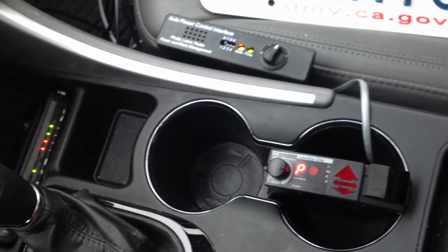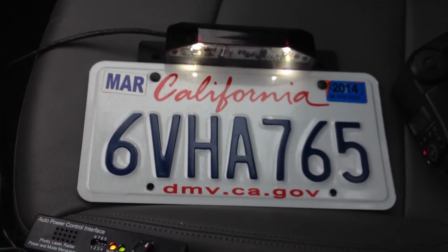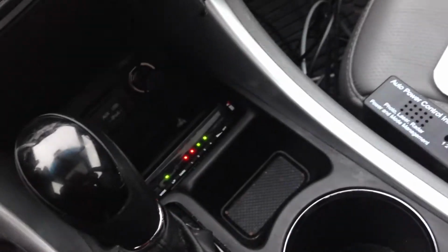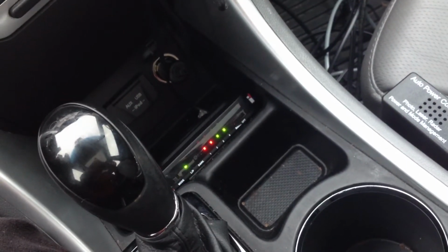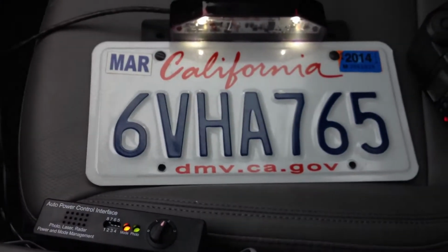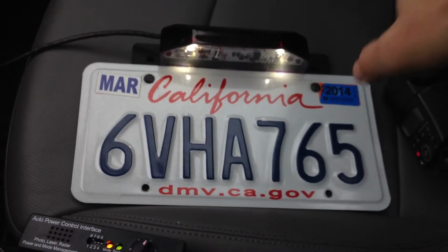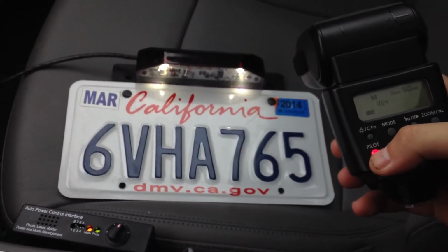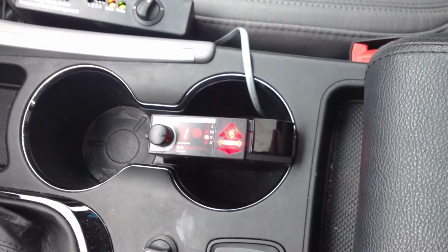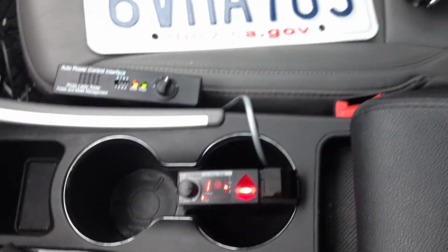The V1 has to power cycle again, as you can see. So when you do this, your ProDB is now also deactivated. So once you JTK, this will no longer respond to flashes. You've got your jammers here, which are now set to just receive mode, not to jam mode. Your radar detector is on, and if you're running an STIR Plus or 9500 CIs, those will stay on as well. So this is set now to not flash. And just to do a quick test of that, still check. Yep, not responding. So, cool. Oh, look at that, my V1 works. Yep, and cool.